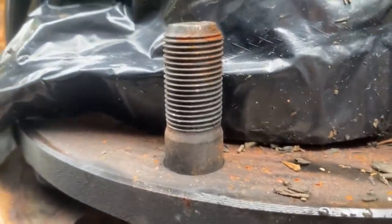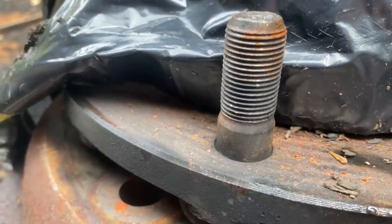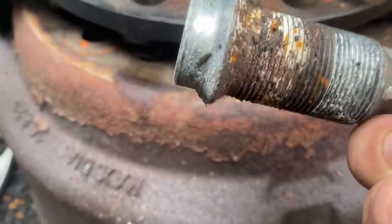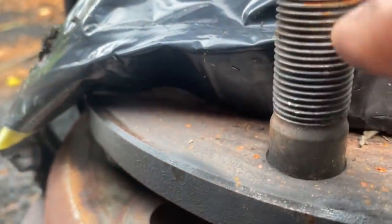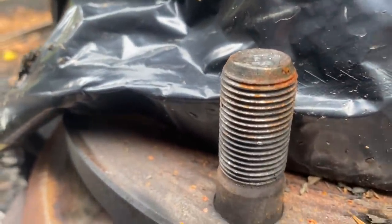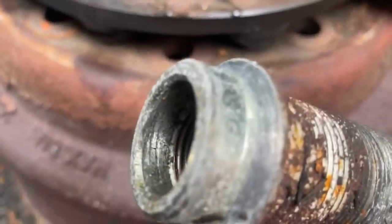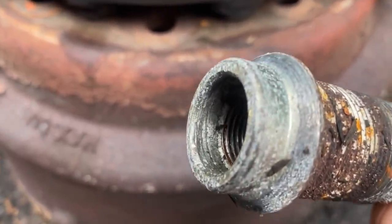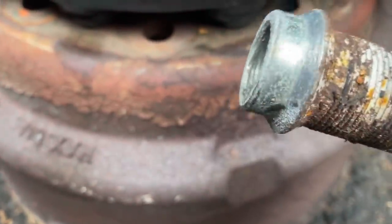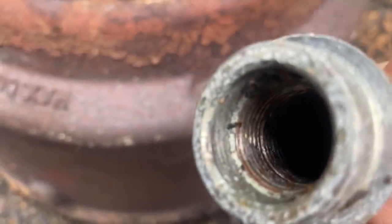One of the first things I questioned as soon as I took the wheels off of this bus was the lug nut — or the stud — how many threads were really holding it on. This had inner aluminum rims and aluminum outers as well. The inner lug nut is for aluminum, but the aluminum rims are much thicker, so the lug nut can't get on there as far. We looked up the spec: the thread engagement distance needs to be at least the same as the width of the bolt. These are actually short, so we found longer ones that will give us a lot more stud engagement. You can also see the inside doesn't start threading right away — there's another half inch or so they could have threaded. We've got longer ones coming now. Looking at the lug nut, you can see how little thread is actually touching — just four threads — so you can see just a little bit at the end that was actually holding it. And they're all like that.